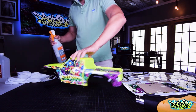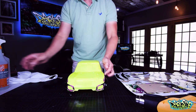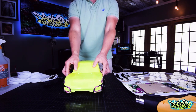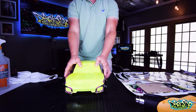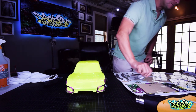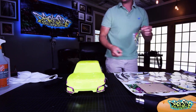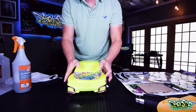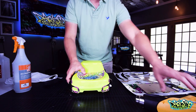Now I've got some small pieces that are going to go in there — we'll do them later. For now we're going to do the hood. One of the reasons I wanted to do the sides first is so you can center the hood in between the two side pieces. Based on where you land the side pieces, the hood can then be centered with a nice gap. If you stretch it a little as you put it up the sides, you can still center the hood and trim the excess off. The hood graphic is actually in a few pieces, which makes it easier for install. I'm going to spray it down — as long as we align the holes, we should be good. I'm going to add a little bit of heat.